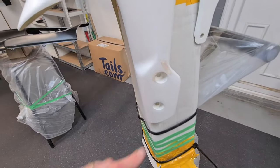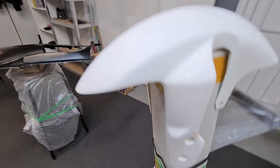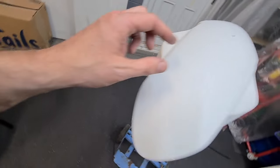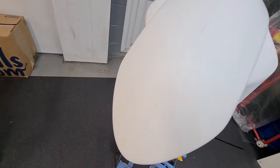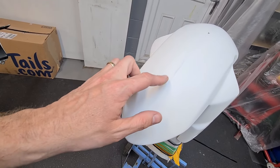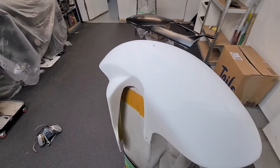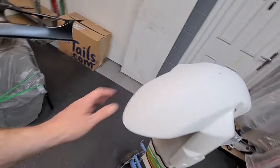Yeah, I'll show you. I put some finishing putty there, it's not gone off yet, because there's a hole in it and a little scratch here. Only thing with fiberglass is the gel coat can have air bubbles in it. End up having to fill it all over. So when you start to sand the gel coat down, you find there's air bubbles or craters. Can you see that there? Get closer. Those little specks, excuse me if it's blurry and flashing, those little specks there are actually like fish eyes, you call them, where air's been trapped in it. So I need to put filler on that. I might try and get away with some filler primer first, but once you put filler primer on, it can be a bit of a pain.